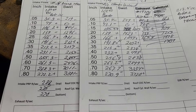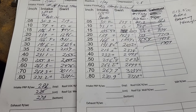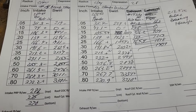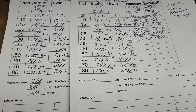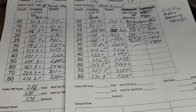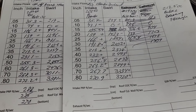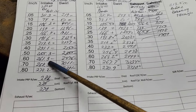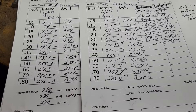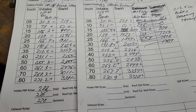So what can we learn from it? Last time it was a big payoff, but I also did a couple other things at the same time — I made the bowl a lot wider at the very roof. It was around the 25th cut, flowing almost 300 at a reasonable lift — that was with a 208. I'm trying to do this with a smaller valve, and I'm not really having a huge amount of success. I was really expecting to do better than this with a 202. I'd like to keep the chamber tight, and when I opened up the bowl ratio, it was a loser — so I need to keep the throat ratio relatively tight.